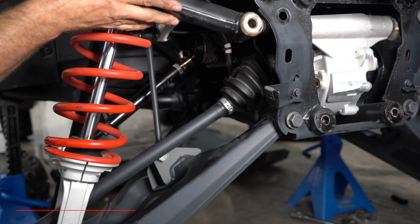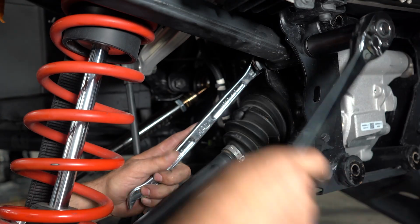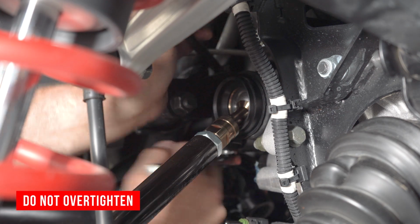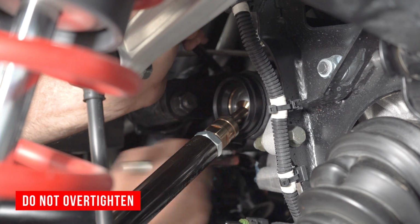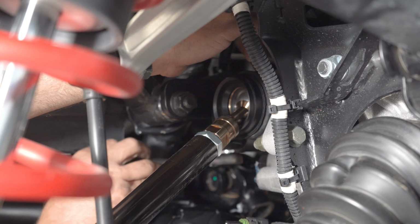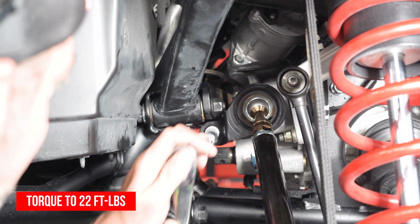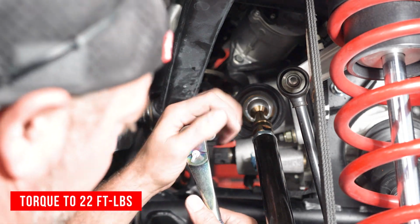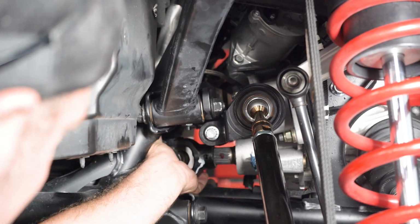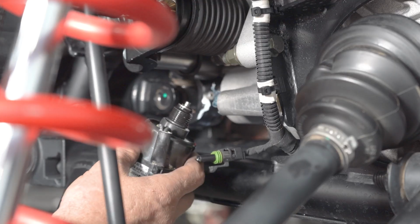Now I'm going to put the upper control arm back into the factory position and put both bolts. Now that we've tightened our control arm pivot bolts, we're going to work our way inward toward the new vertical bolts. We're going to tighten them just until they stop. That is all. We're going to finish up the stabilizer body by tightening the two 12-point half-inch bolts for the ears to the stabilizer bar. And now we can move on to the drive shaft reinstallation.